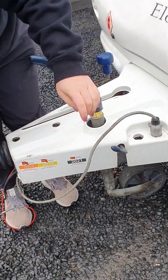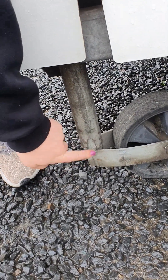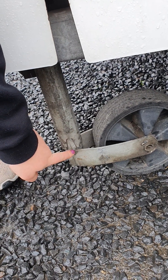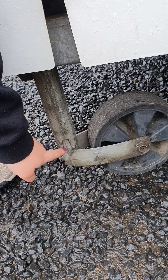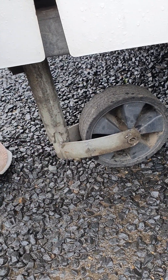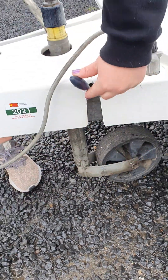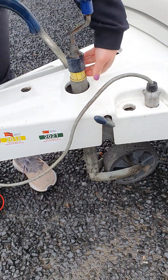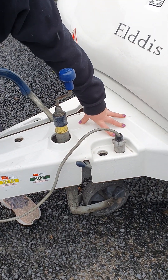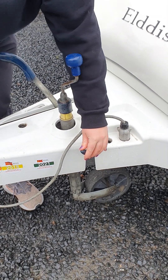On your jockey wheel there are little grooves — those are designed for these arms to go up into, so that your jockey wheel is raised to its highest point and also stops it spinning around. Once the van is on your vehicle and you've wound the jockey wheel right up, you can undo this handle and pull the whole jockey wheel mechanism up into your A-frame to get it out of the way, then just tighten that back up.